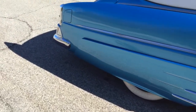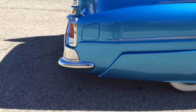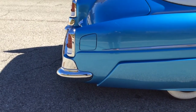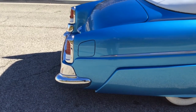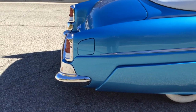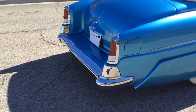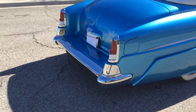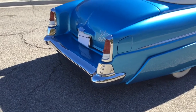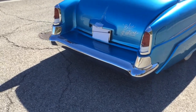Keep moving around the side. The rear end — there was a ton of work done back here. Just in front of the gas tank door is the part of the fender that I grafted into the car — this was off a 1955 DeSoto. I found a guy parting one out; he had the bumper, the tail lights, and all the widgets and goodies that came with it. The rear bumper — I cut six inches out of each side, so the rear bumper is actually a foot narrower than the original DeSoto. These cars have a shape that kind of boat-tails to the back.